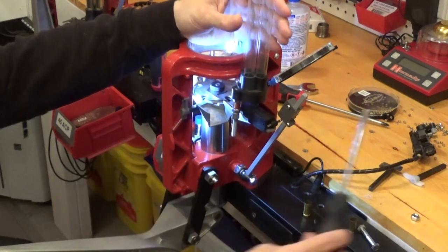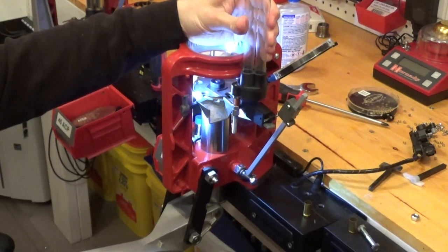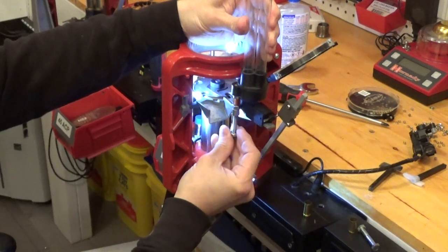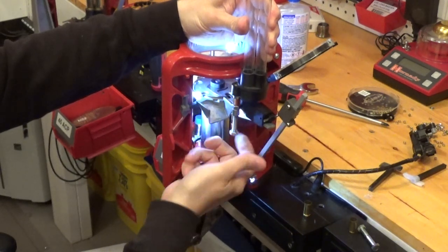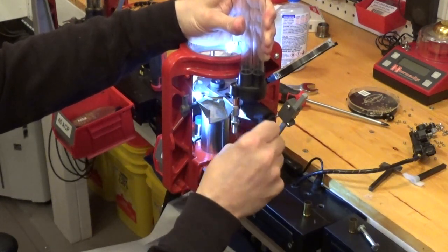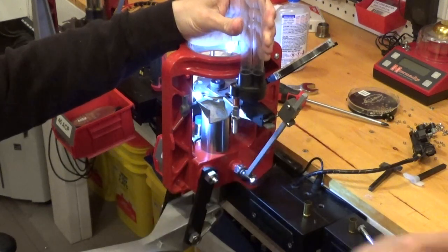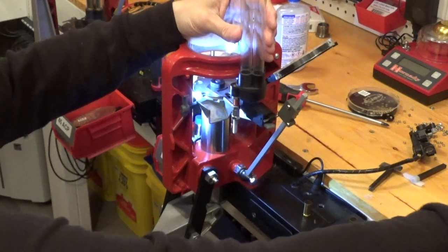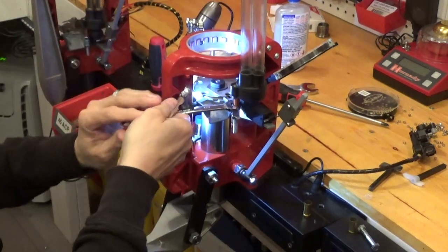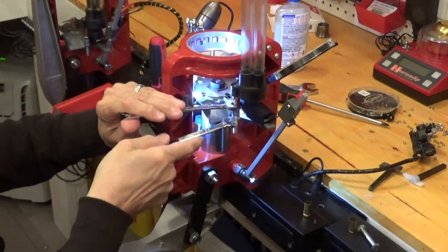We're gonna set that. And I usually set it, I would say I'm pretty consistent, about an eighth of an inch. So you're gonna take and put the nut back on the bottom of this. Alright, you're going to need two 7/16 inch wrenches. You're going to put a wrench on the top nut. Keep that about an eighth inch away. Go ahead and tighten up that bottom one.